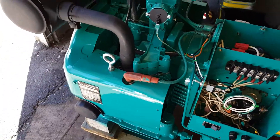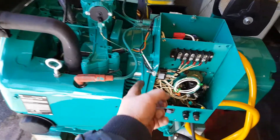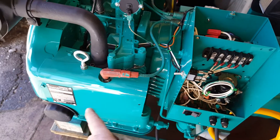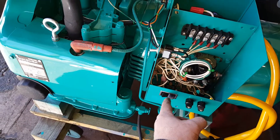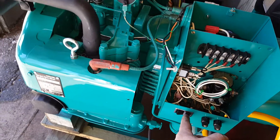I just hooked it up and did a test run — it seemed to function well. In the up position it's going to trigger off of the points; in the down position it's going to trigger off the electronic ignition. We'll start it with the electronic ignition first, and as it's running I'll hit the toggle switch up — you won't notice any difference, hopefully.